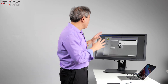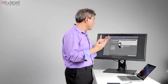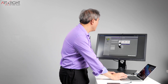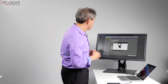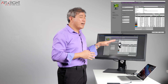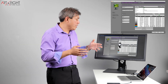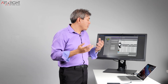The calibration is done. I'm able to achieve close to 80 candela — the value I had set — and the target color temperature of 6500 Kelvin; I got 6490, which is very close. Running validation, and there we have it: using this hub with a DisplayPort cable, I'm able to get a validation pass. The hub is not doing any signal manipulation — it's not truncating the RGB signal. I've also confirmed HDMI works off-camera. So we're not going to have any issues here.